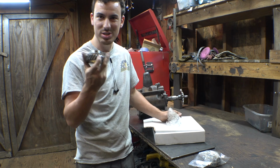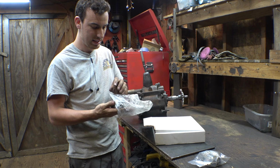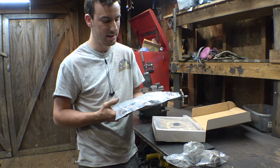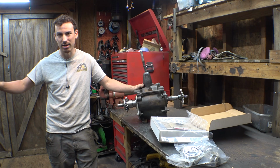The second gear in this transmission, you can see that it's kind of worn down just a tiny little bit, but while I'm in here, might as well replace it because that was the one that was giving us trouble with the last transmission, so this thing wasn't that expensive. Also, I bought a rebuild kit for this transmission. Came with new bearings, new synchros, new needle bearings, new wear washers, all that kind of stuff as well as new gaskets for this transmission. So, let's take it apart, replace the parts that we're replacing, and then reassemble it, and then we can reassemble this back on the frame.